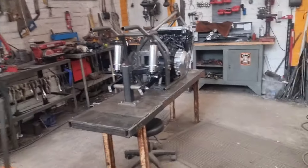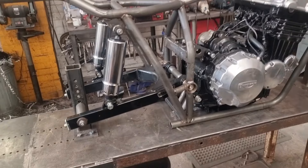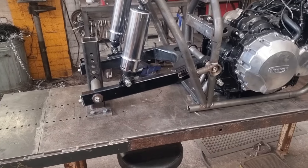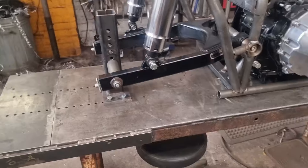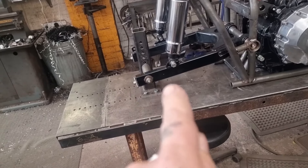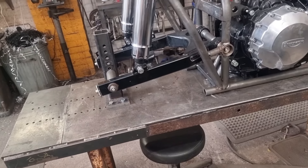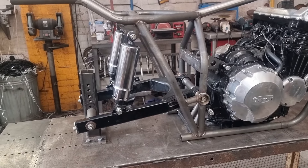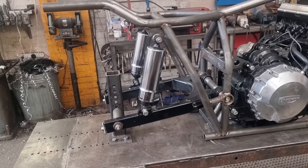Up on the bench again is our Mixed Triumph swing arm. Do you know what? I'm really liking that. What we've got to do is replace this — I think we're going to go twin rail, two rails with my pillbox adjusters on the back. Fresh swing arm, fresh everything. We're going to develop it as we go. So first thing is to make the pillbox adjusters for the back. Let's get on that.